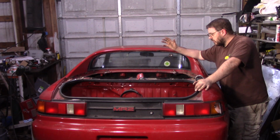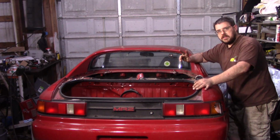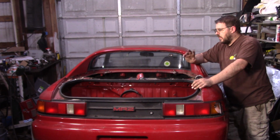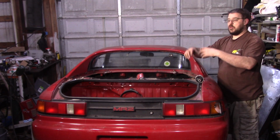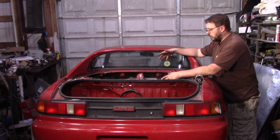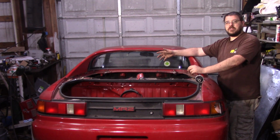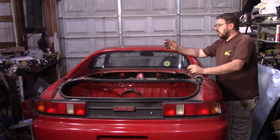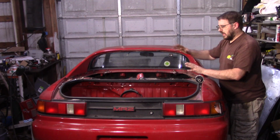Yeah, and then we'll take that to the dyno. My plan there is to get the number 2 grind that I made tested out. That should be about 250 wheel horsepower if you're using, again, that same header that I'm using, same intake manifold, well, stock intake manifold, and my mass airflow velocity stack. With that combination and the appropriate tune, I'm expecting that to make 250.